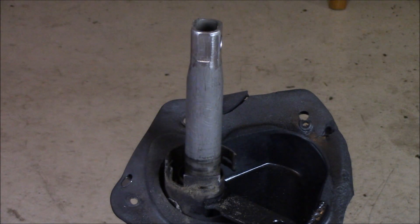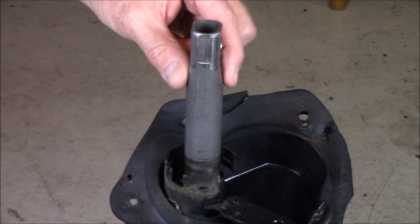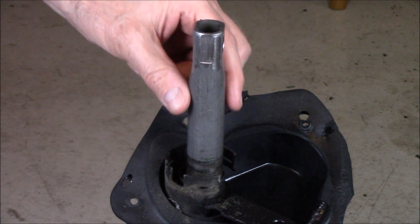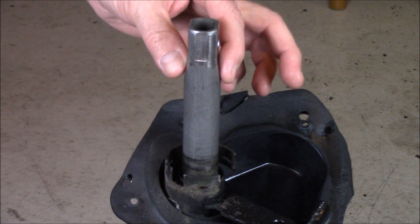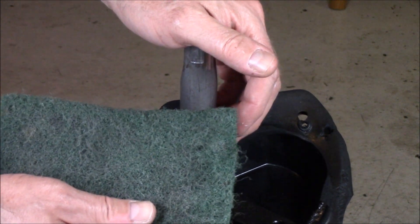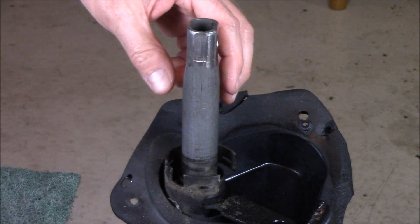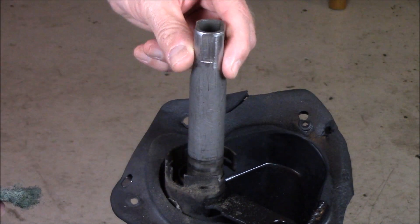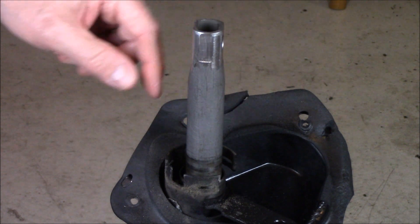We're going to do a little bit better now by putting a bearing on it. As you can see from how much movement there is with no bearing in place, you're going to have to clean this thing. If there's any dirt, any grime, anything on this, you're going to have to clean it down because the bearing is going to be really tight going on here. So I'm going to just use Scotch-Brite. I've got most of this cleaned up — I'm just going to get the little part where the bearing was. This has to be as smooth and clean as you can get it.